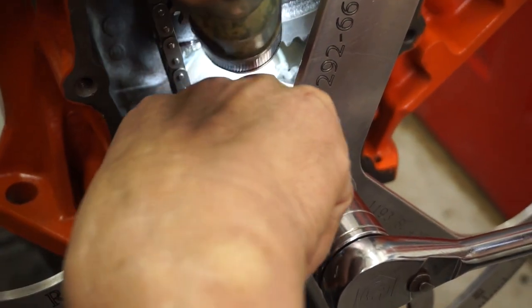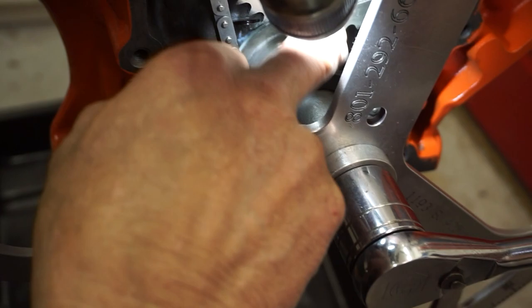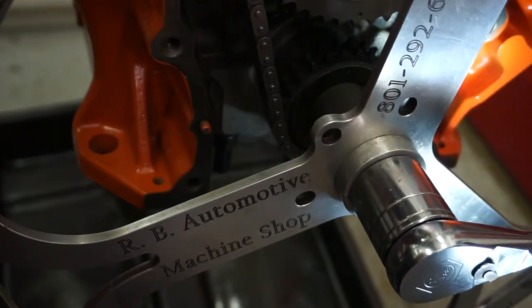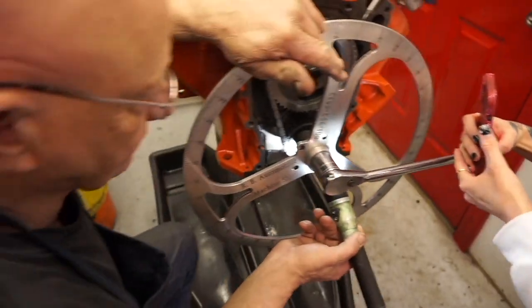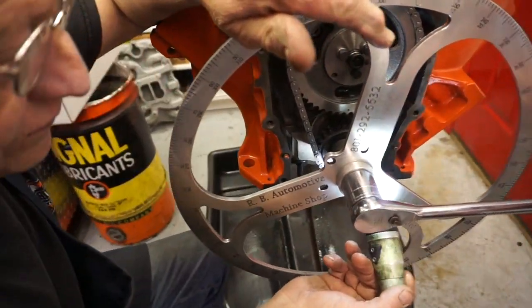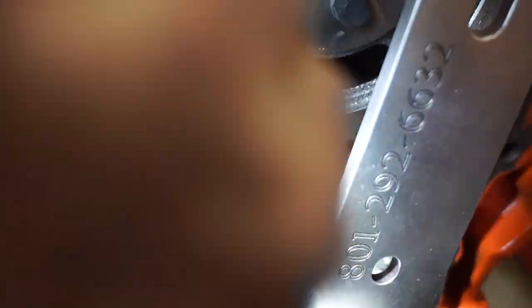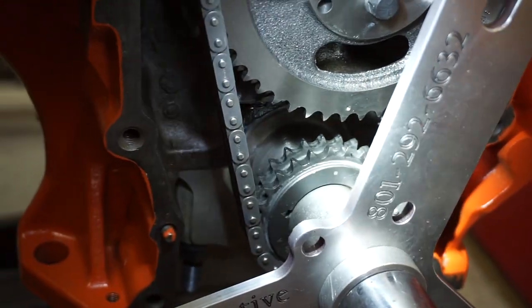This is marked A and this is marked A. So if you were going to advance the cam, you pull this gear off and turn it around and put that A right over the keyway. And then this A would be your new timing mark in relationship to here — and vice versa. If you're going to retard it, it's marked R over there and you wind up backing it off the other direction. So it's a solid filled-in dot — is that pretty much standard for all blower cam gears? Yes, of a performance nature.